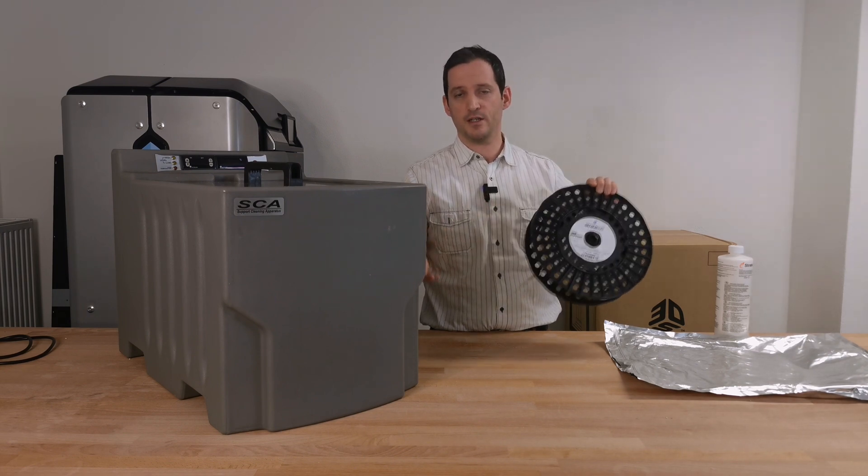And you can use this to cook meat. I don't know if you have seen this before but I didn't. This is called a sous vide stick. You just dial in the temperature and how long it should cook your meat, then you just put it into water and let it circulate. Everything is in there — there is a heating element, there is some kind of impeller to circulate the water, and there is the temperature control. So actually our DIY project is just sticking this into some kind of a tank and letting the support material removal solution circulate in there.